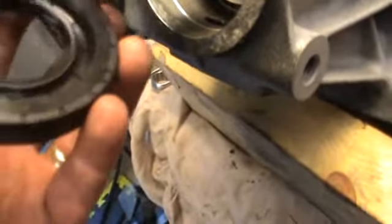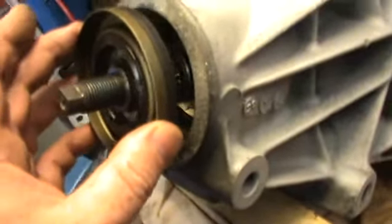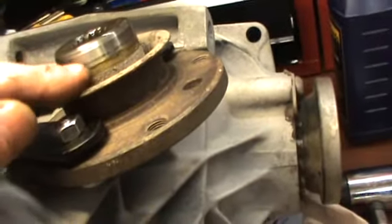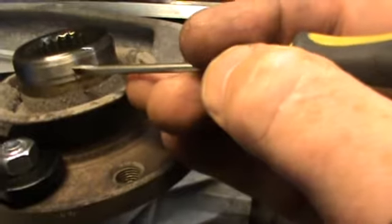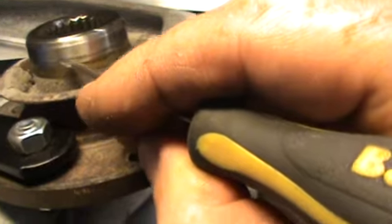I think this should just go sliding right up, but you see these sealing faces here. I'm going to adjust possibly this by, I'm only talking 1/2 mil to 1 mil, so that the seal might run not where the original seal ran. Can you see that line there? That's where the original seal was running, I believe. Right at the tip of my thing, there's a black line going all the way around there, you can see it. I'll see if I can adjust it so it's either there or there.